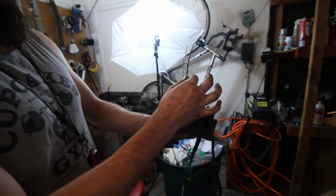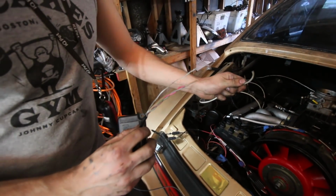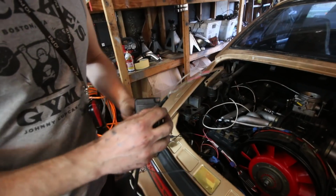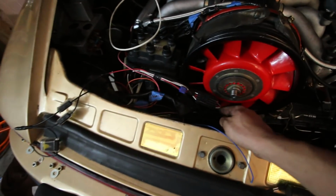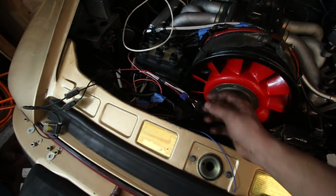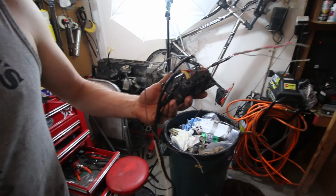And then these guys right here are the PIP and SAW, which are going to go to this other set of shielded wires, which is already running up into where the ECU is going to mount. So that's how Megasquirt gets its signal. The VR picks up the signal from the toothed wheel, the VR goes to those wires, and these wires go to Megasquirt, and the Megasquirt knows how to operate EDIS, basically. Yep. It's really just a 1 or 2 wire splice, and it's not a difficult install at all.